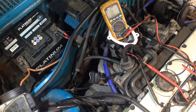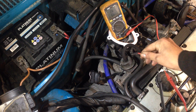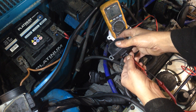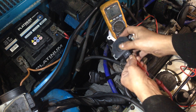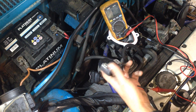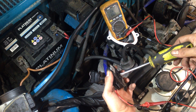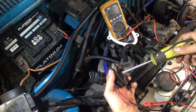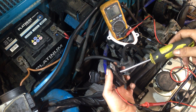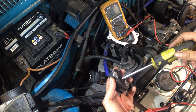That click should create a resistance or complete a circuit. Now we're going to take these pins and connect them one to one, then show you what should be happening. Watch the multimeter — this is how the ECU knows that the throttle is closed and needs to maintain a target RPM.